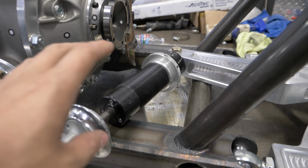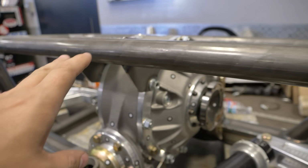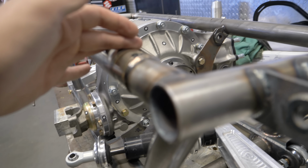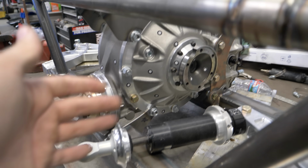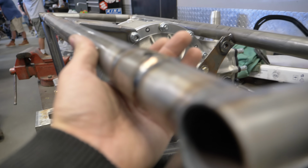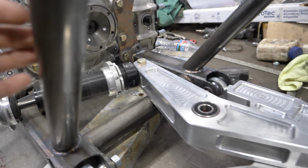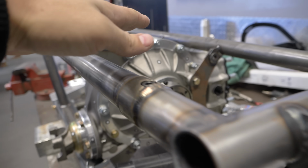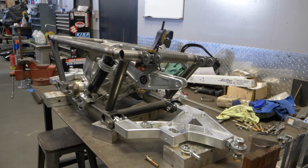One of the difficulties that I did not foreshadow was the need to brace the upper control arms and the differential. The problem is that actually gets right in the way of where my shock was going to originally travel. So these guys have come up with a nice little solution to bring it up on the inside and then cross down onto the outside. Nice little cross bar sort of action going on with the cantilever that really lets everything work in a tight, small amount of area that brings it up to maybe at most like up here.